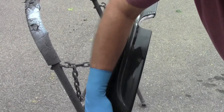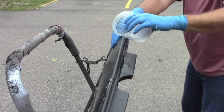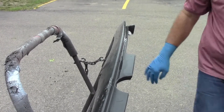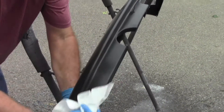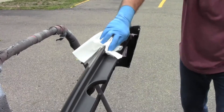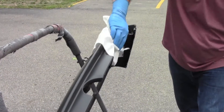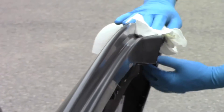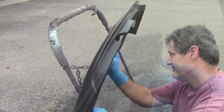When you're done with all the abrading, make sure and rinse it clean. This is where you'll really appreciate a cleanser instead of heavy compounds that may leave residue on the surface. Rinse it clean, and when it is finally clean, dry it off like you would when degreasing. From this point on, treat it like you're top coating it — really dry it off carefully, inspect it, get around all the edges, and don't forget to wipe down the inside.